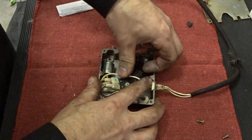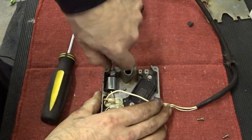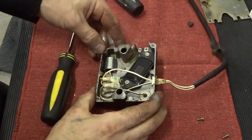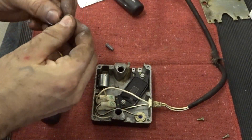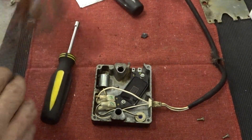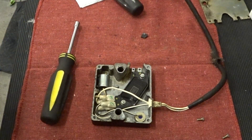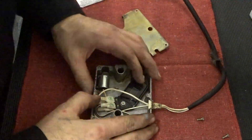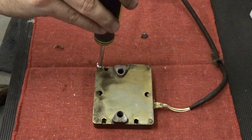Put our wiring back here, and since we had removed it, we went ahead and put back our condenser. And there we go — that's gone ahead and rebuilt our piece. Now, we do have our connector that broke. We can either epoxy that on and reuse it, or we're going to check the local parts store and see if we can get one. Before we deal with that connector, we need to put the front plate back on, simply done with four small bolts. And then we need to deal with our wire insulation.